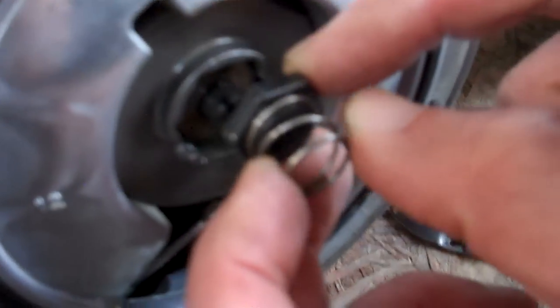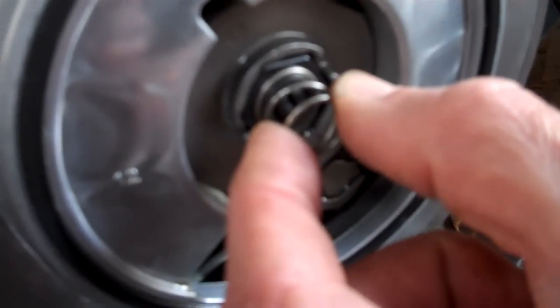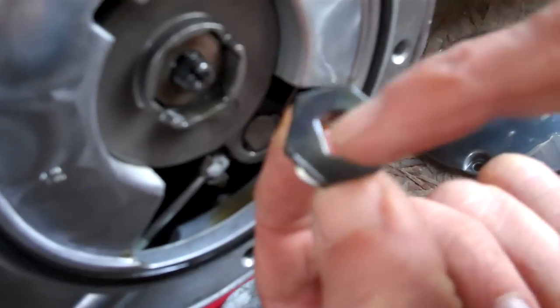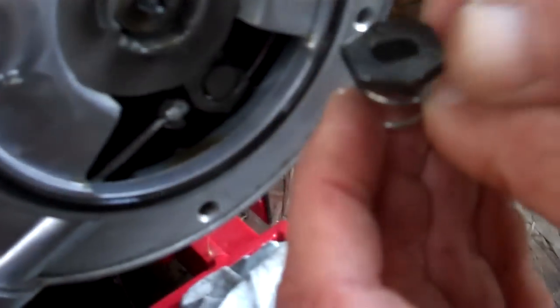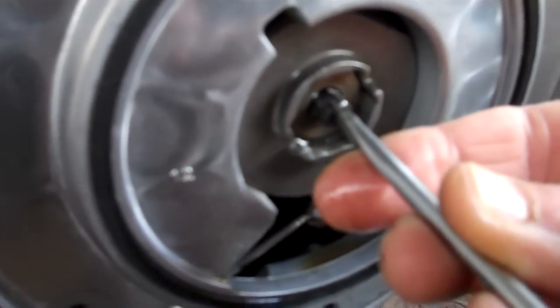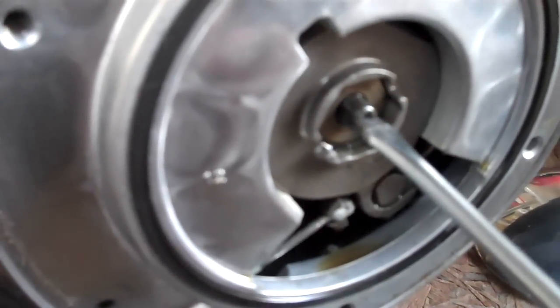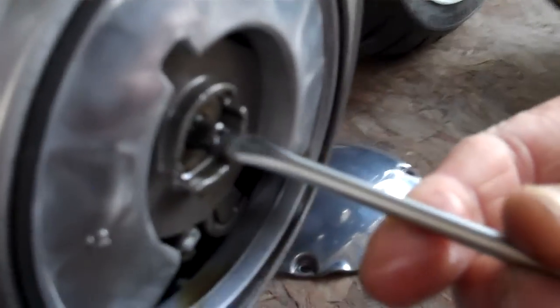This is the actual adjuster. This little piece lifts out under its own pressure — it's a hex nut with a spring attached in a hex housing, so when it's in place it won't rotate. It has two shoulders, and the adjuster screw also has two shoulders. Those shoulders hold it still when inserted, and the outer housing holds everything frozen. To adjust it, take it out, set it on something clean so no grit gets on it, take a flat-bladed screwdriver, and with all the cable slack removed, back the screw out until it seats.